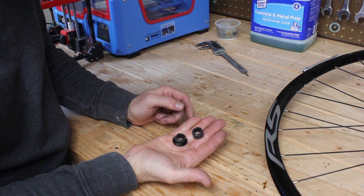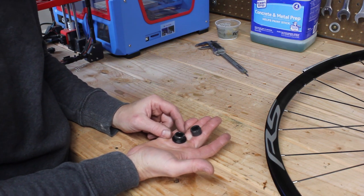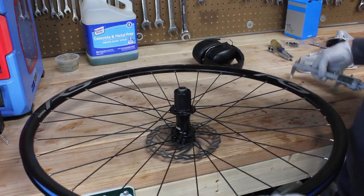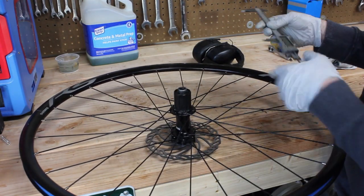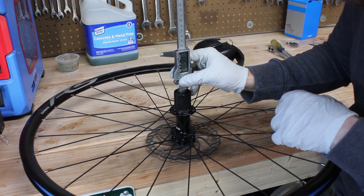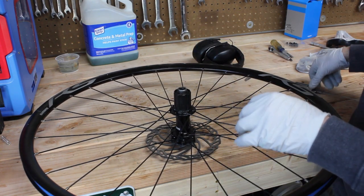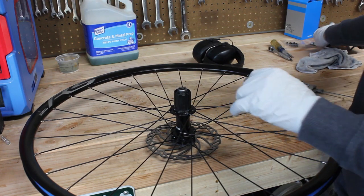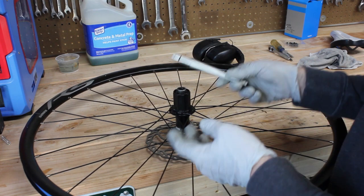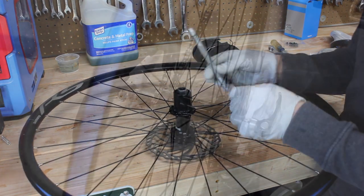I'm pretty happy with how they look. I haven't tried them on the bike yet, so I'm going to put the axle together and take some measurements. I got everything back together and the bearings are all tightened down and preloaded correctly — it feels really good. And best of all, it's just a lick over 135, which is exactly what we were hoping for. I've got to get it on the bike now to see how it fits, but the adapter I made before won't work — I've got to modify it to fit in here.